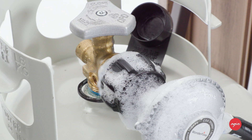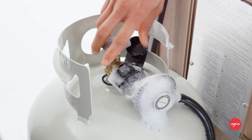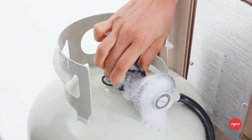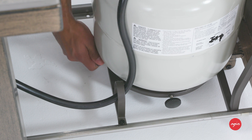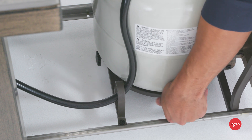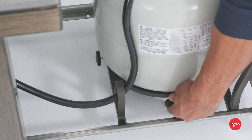If you see bubbles in the soapy water, this indicates a leak. Close the tank valve and tighten all connections, then repeat the test until you see no bubbles. The tank tray has threaded knobs G, which should now be tightened to keep the LP tank from shifting out of position. Be sure to not remove the plastic caps from the ends of these knobs.